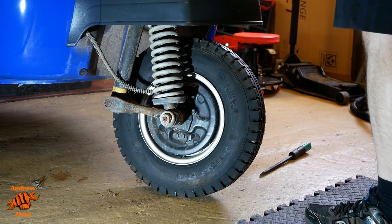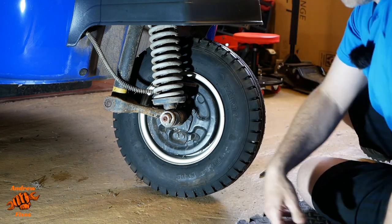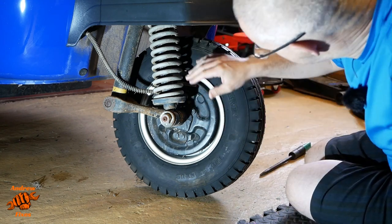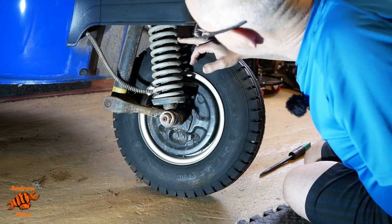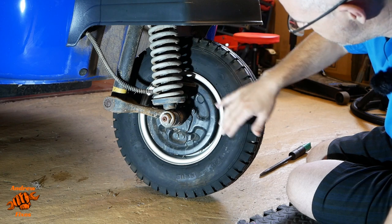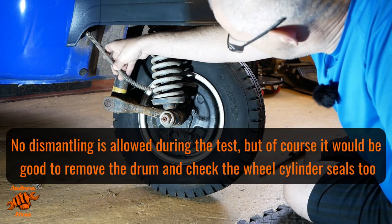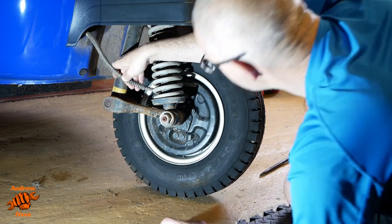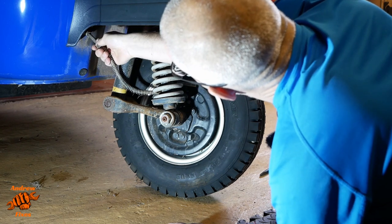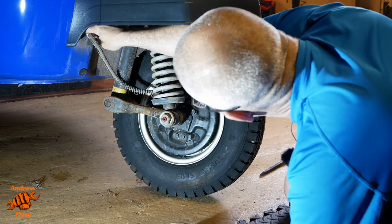Let's move on to the front wheel — here we're looking at steering, suspension and brakes. Check your spring is intact — this one is. Check for leaks from the damper underneath — there's no leaks there. Check for any leaks out of the back of the wheel cylinder. Have a good look at the state of your brake flexible hose, which may include sliding the chafe protection back — give it a bend, check it's not perished, not damaged or leaking anywhere.